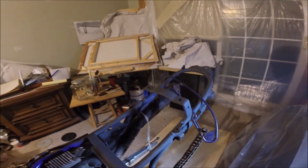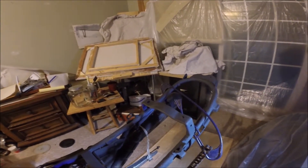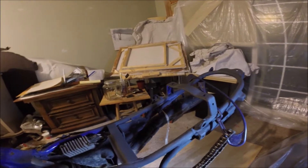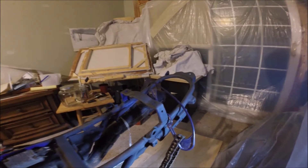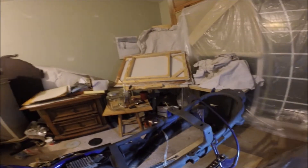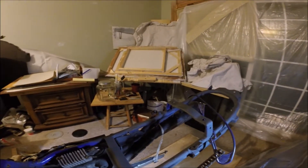We had to remove the rear wheel so we could get back in there to the nooks and crannies — I want it to be even, don't want spots missing. The front wheel was also removed to paint the fork springs. I plan on painting them separately as their own thing. I also have the chain hanging up right here — all I had to do was pull it off the sprocket. We'll go over wheel removal later on. Right now let's get to sanding — we're going to sand down that swing arm with 180 sandpaper.